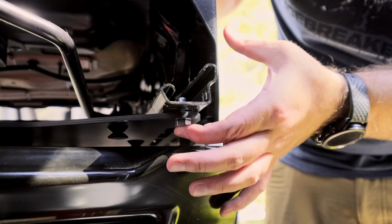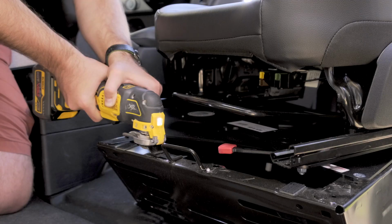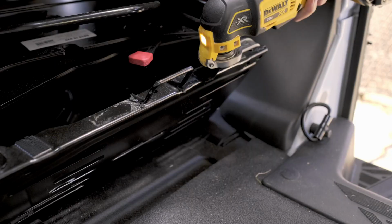Yeah, the only real hurdles that I ran into were, again, the mounting hardware, but it was the orientation that I had installed them initially was causing a clearance issue. So if you just mount the hardware from bottom up as opposed to top down, you shouldn't have any issues. The next issue that I ran into was that kind of like handle on the back of the passenger seat. From what I can tell, that's supposed to be like some sort of an anchor point for a child safety seat, but that makes no sense given that it's a front row passenger seat. So I'm not exactly sure why that is even included, but it's easily removed, thankfully.